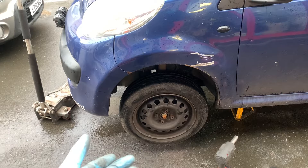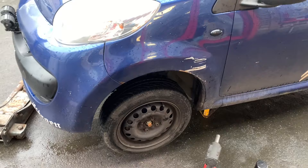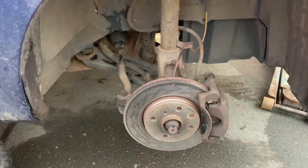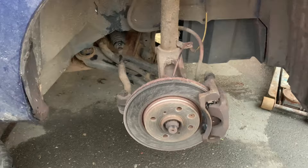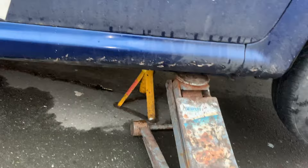Right, so I'm now halfway there. This is near the end of the video as I'm not going to film the other side. The wheel's back on this side and now I need to do the same on the other side. I've now done the same on the other side — it's all pumped up and the wheel is ready to go on. One thing I didn't mention: this brake hose here, when you take the caliper off, if you let it hang all the way out it can twist — make sure you don't do that because not only is it an MOT failure, it's your brakes and they can fail. Now I'll put the wheel back on and remove the jack stands from both sides.